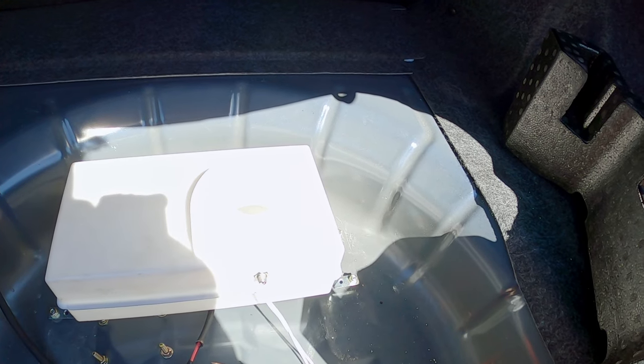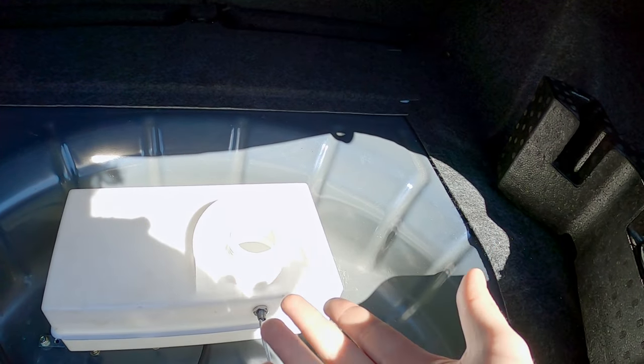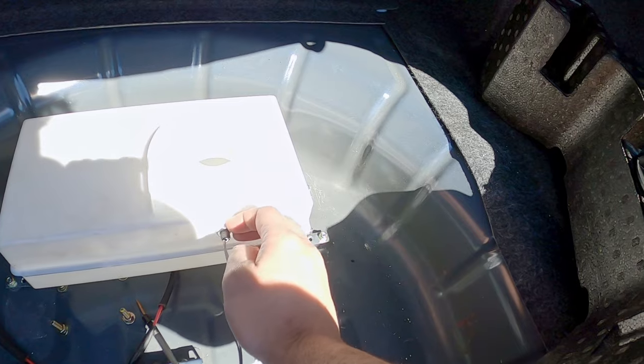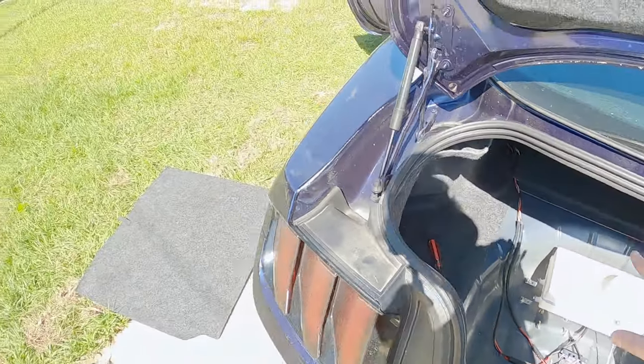And in order to do that, I have to take the tank out, drain it, take the float out and reseal it. And as much as it's sealed up fine, it seems, I may use some silicone next time, and that will fix that problem. Oh my God, I tell you, it's just one thing after another with this project, man.